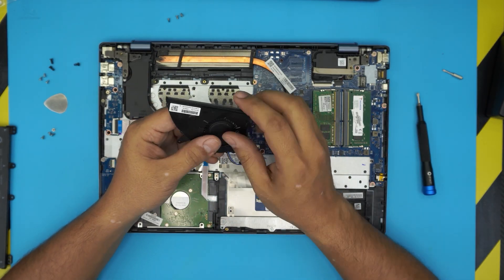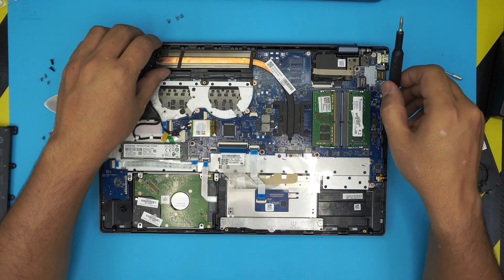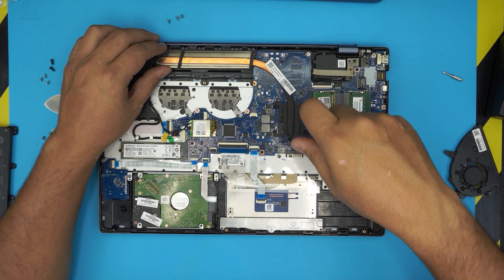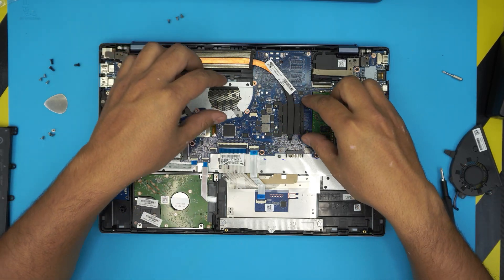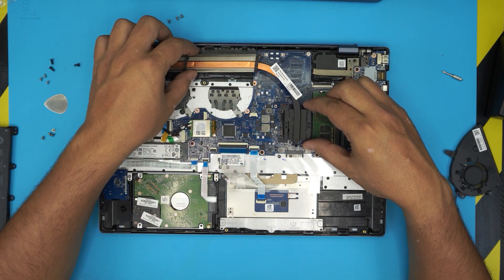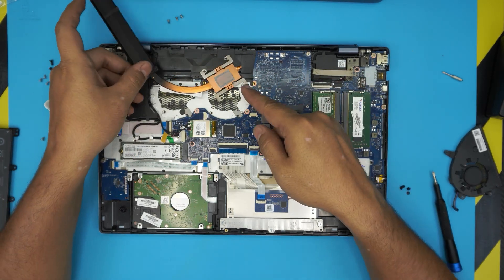Use a toothbrush and air compressor to clean your fan. Next, remove the heatsink by removing the four screws on the X-clamp. Once the screws are out, lift the heatsink up from the correct end — do not lift from the heat pipe end or you will bend it. And there you have the stock thermal paste exposed.